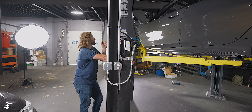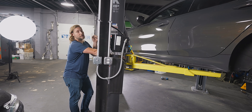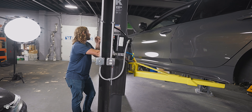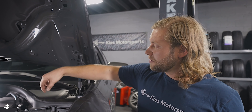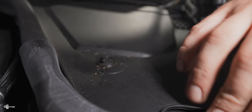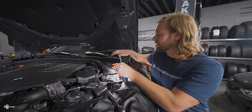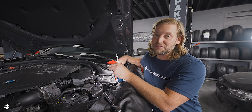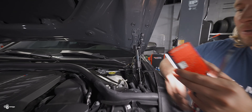For the front, I need the car significantly lower because I need to get to the top of the strut mounts. I'm going to put the car down pretty far and then resume. First thing: there's a little clip right here — you just twist it and pull up and this whole cover comes off. I love how simple that is. On F30s and F80s you normally need three little 10 millimeter nuts, but on this car it's one tool-free clip. Good job, BMW.